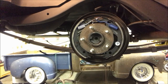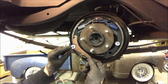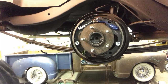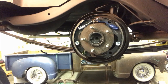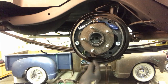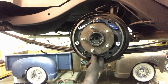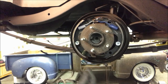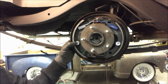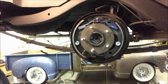Then the last thing I'm going to do is put the retainer lever in there. This has to go behind the wheel spindle and it has to hook. We got it all put back together. The last thing was putting this adjuster bracket in — it's hooked down here around the adjuster, and it's got a new spring and then the retainer. That's kind of tough to get aligned and pushed in there and then get this retainer spring in place. Fuss with it enough and it'll work.